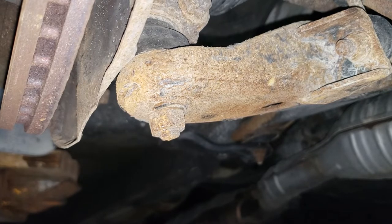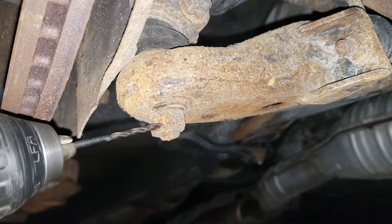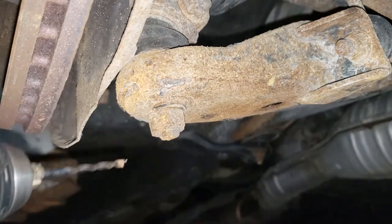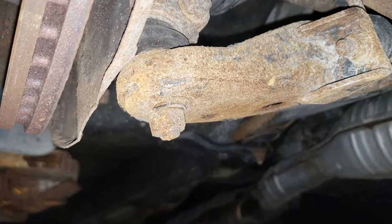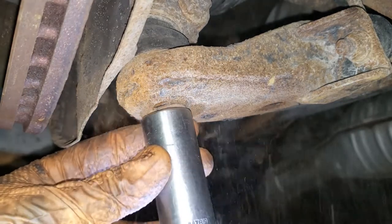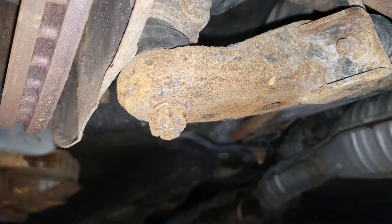It is imperative that whatever drill bit you use does not break off inside there, because if it does it will ruin whatever little happiness you have left. You only have to do this if you are not replacing your ball joints — if you're reusing them you have to make sure the cotter pin hole is free; if you're not, just hammer it off. Someone didn't twist this enough so we have to twist it some more — we'll use the impact to do that. Continue drilling.